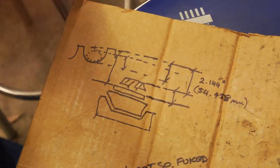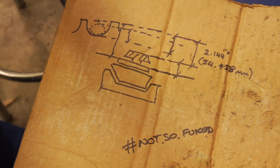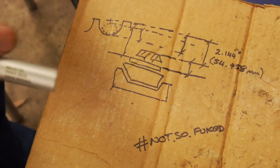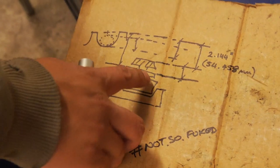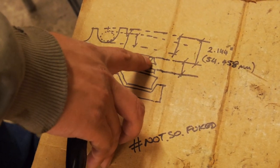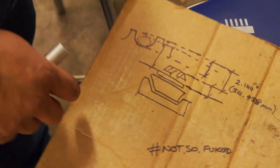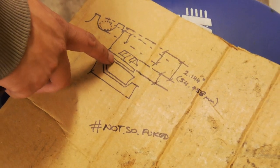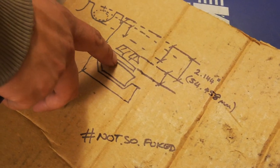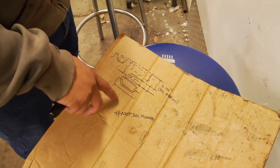So normally, in other manufacturers, they put a shim under the cup here to adjust the pinion height. Toyota decided they would put a spacer here. Couple of reasons. Maybe it's also to control oil egress from the gear or other things like that. Not sure. But if it's not there to control the oil egress, it's a really stupid spot to put it, because the ring is really tight on the shaft. So if you have to change that, you have to pull the whole bearing out.